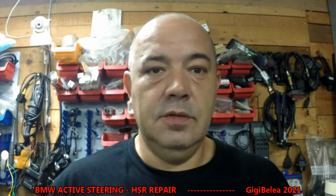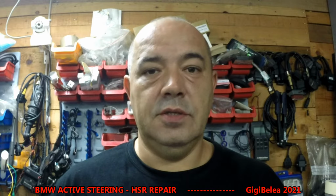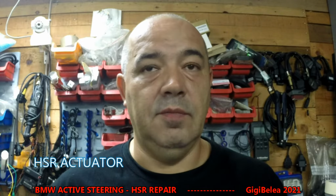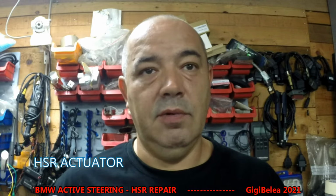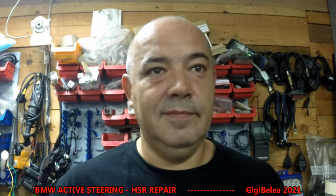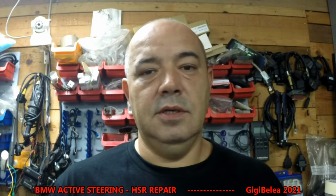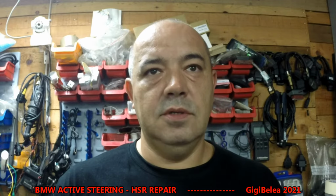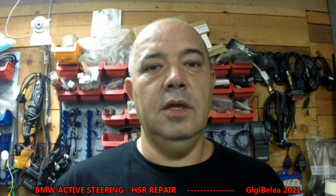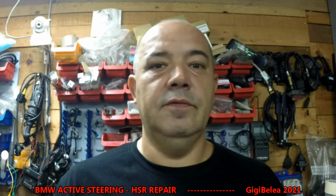Today we are going to take a look at the BMW HSR unit. I tried to find what exactly that means and I couldn't, but I will tell you what it is. It's a small, depends on how you look at it, actuator, electric motor that's installed on some BMW 5 and 7 series on the rear axle, and it will act as a steering rack for the rear axle.